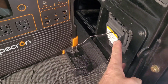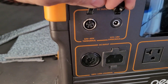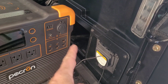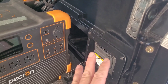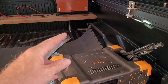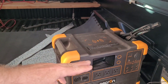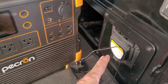So you can't just use the AC cord with your power station plugged in here and be happy. You're going to have to somehow convert the power to a form that the power station can take, which means converting it to DC and feeding one of the solar charge controllers that will accept a DC current. That's the only way to make use of the wires already run to the bed of your truck and the 120 volt AC inverter that Tacoma has. If you don't do that, you end up having to go to the alternator, put in a DC-to-DC converter that will feed via big 10 AWG wires back into here — it's way more expensive and a lot of work.